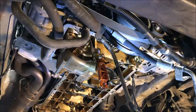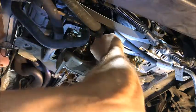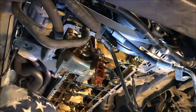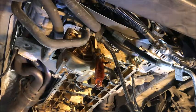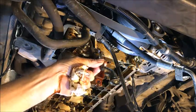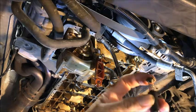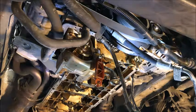What we could do is just go ahead and pull this old pump — it'll make it a lot easier to get to that. We can drop it out. We'll leave that loose for right now and push it back up to where it's supposed to be just for reference. Out came the little piston after a bit of sitting. This little plunger sits on top of this little spring — this is the unit that goes up inside of the hole, that's your tensioner piston. So the plunger sits on top of the spring, and all that rides together. When we get ready to do the reassembly we'll change all of those out and we should be in good shape.